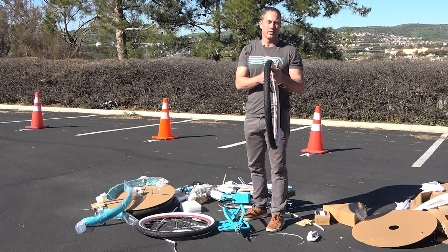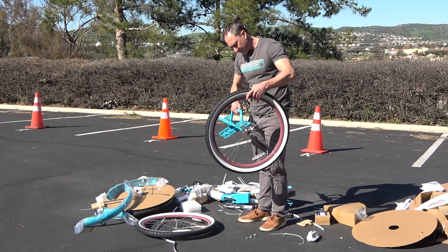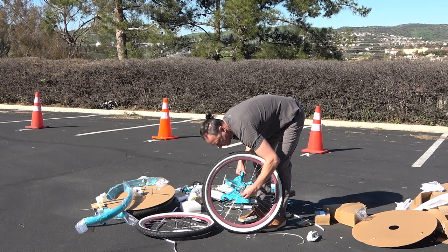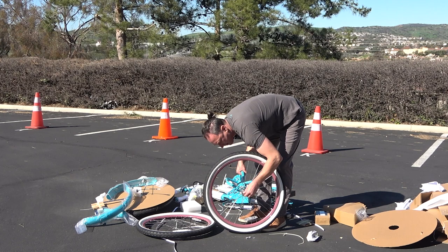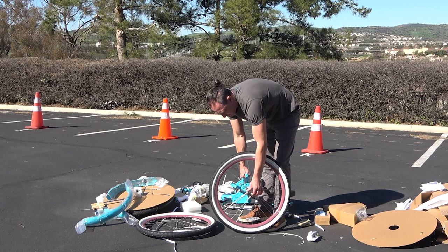On the left side here is the D-shaped axle — that's the left side. It just slides right on. Then I'm going to go ahead and put the washer on, then one of the regular axle nuts all the way down. On top of that will be a nylock — a metal nut with a nylon insert used to lock the nut in place so it won't move. This one can't be turned by your fingers; you have to use a tool. Don't be concerned if that second one doesn't go on all the way with just your hand. The nylon stops it — that's the job.